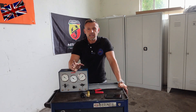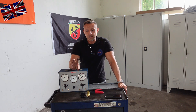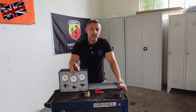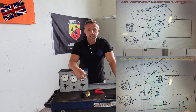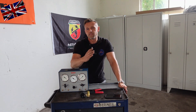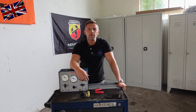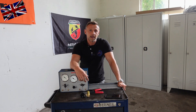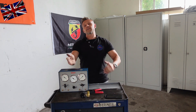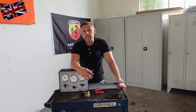What did we get done today? We checked two components; hoses and pipes were tight. We checked them with thermal influence and vacuum, and noted that one component was obsolete after August 87 when a thermally powered part was replaced by an electrical component. You do not need the blue Bosch unit — I just want to brag about it, I just love it. A simple generic hand pump will do as well. Thank you for watching; hope to see you around next time for another episode. Bye-bye everyone.